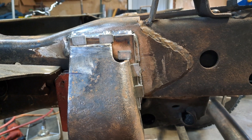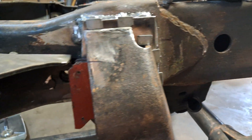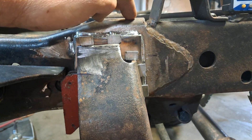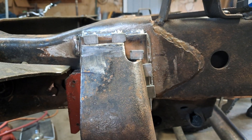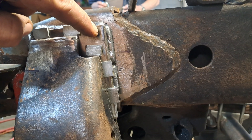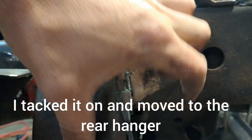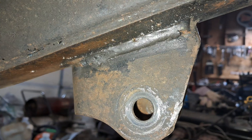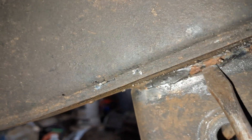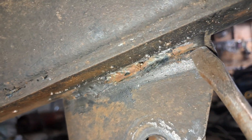I have this placed about where I want it. The magnets — the little square ones are from a Hoverboard, they're really strong. I've got a welding magnet in there, but I got this set about three-quarters of an inch from there. I got my inch and fifteen-sixteenths from here to the top of the frame, and over here is a quarter inch off of the one piece that's on there. What I did was I set the plate an eighth inch away, and then put this an eighth inch off the edge of the metal — that'll put me a quarter inch off the end of this plate that wraps around the frame. Here's the original weld on the spring hanger, and it still has a beautiful piece of slag over the top of it.